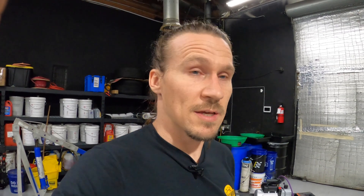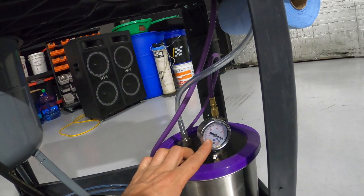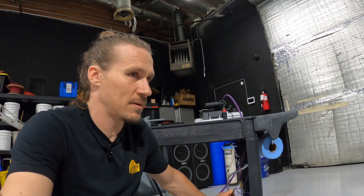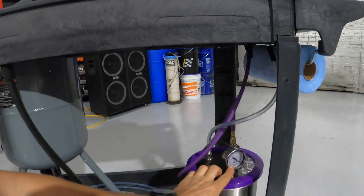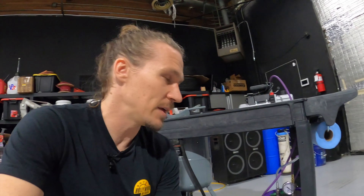Once you've done all four corners — with the vacuum still on — tighten everything up. You'll start to see this little gauge go to a higher and higher vacuum. Once the needle no longer moves, you've gotten the air out of the system. You don't need to let it draw forever; once the needle stops moving, close the valve disconnecting the system from the vacuum pump, then turn off your pump. That needle should not go down — if it is, you have a large leak somewhere. Even if it doesn't move, that doesn't mean there are no leaks; you can't draw a vacuum nearly as strong as the pressure in track mode for the McLaren or maximum dynamic mode for the Rivian, so you may still develop a leak once recharged.